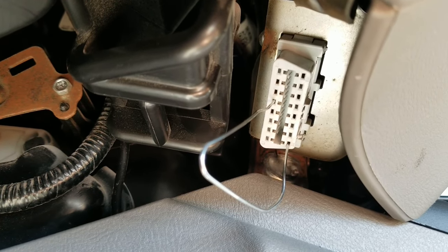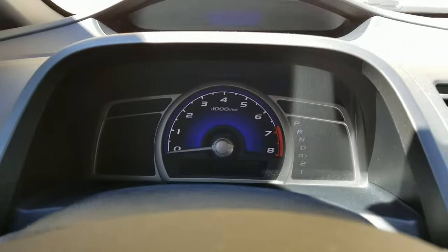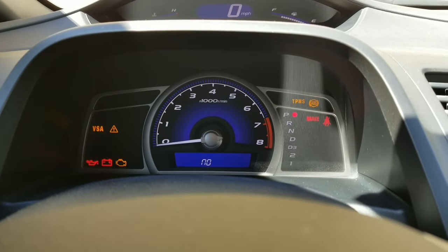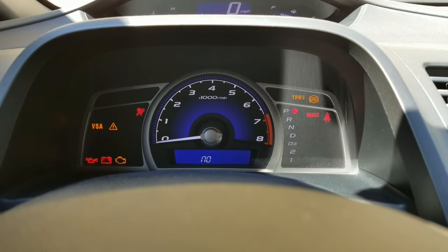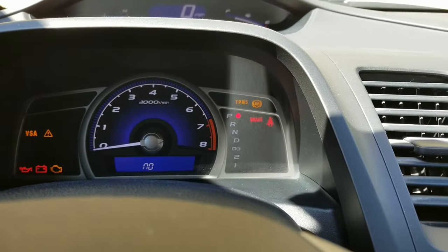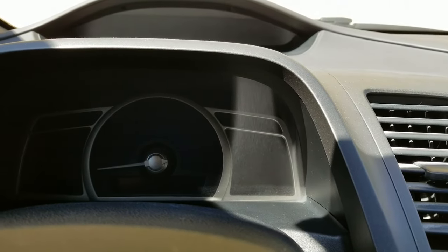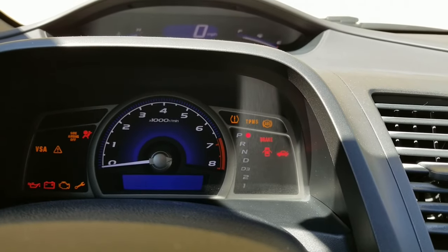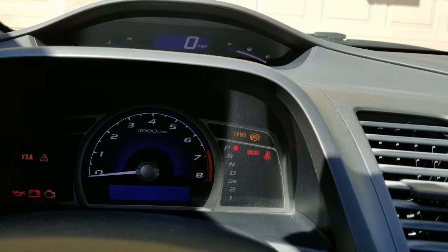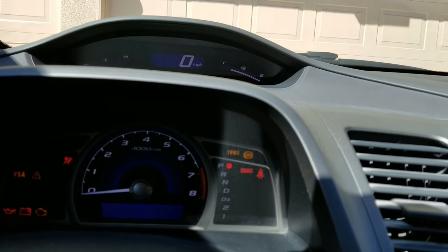Let's go up there and turn the ignition on. I'm going to hold the brake down and then turn the ignition to the on position — don't start the car. The ABS light went off. Once the ABS light went off, we're going to release the brake. Hit the brake again, start ignition on, ABS off, let go the brake — ABS is going to come on. Hit the brake again, ABS comes on, and halfway it's going to release — blink twice: one, two. There you go, we just reset the ABS.